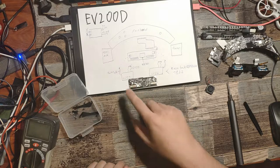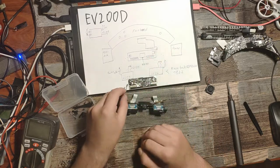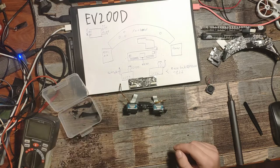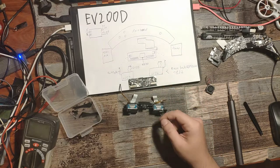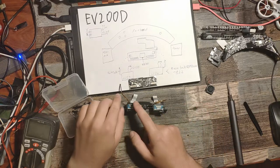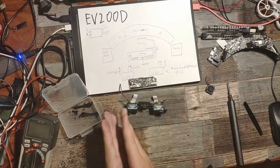My guess now is that there's a problem with the cable connection inside, or maybe a problem with the voltage circuit for the background illumination on the left side. I'm not really sure how to fix this, because I would try checking all the voltages on the right side and finding the same test points on the left side to see what voltage is missing. But the problem is: if the left side doesn't detect a display, it won't put out voltage at all, so I can't compare both sides.